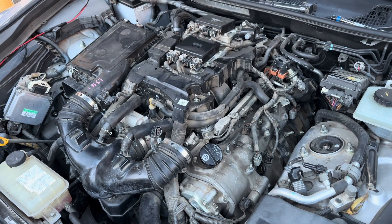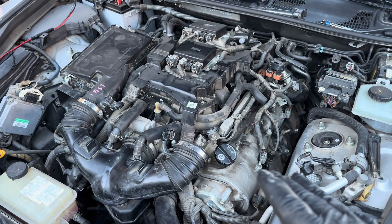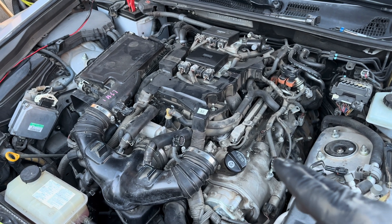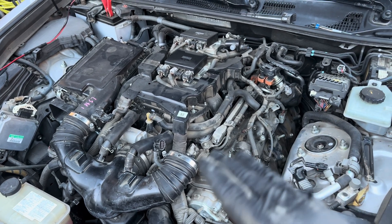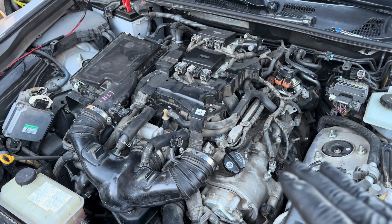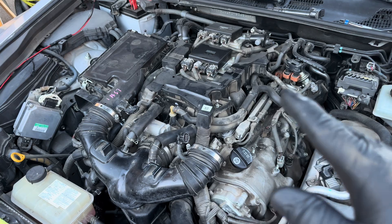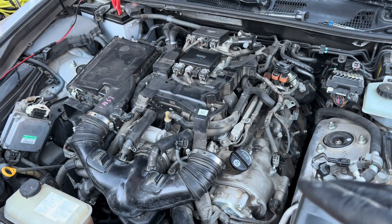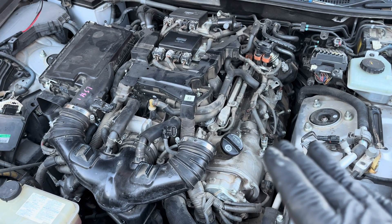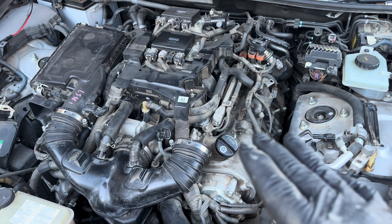I have to recommend it — it does work. But preventive maintenance would work even better if it had been done from the beginning. With any direct injection engine, if you get a new car, buy this stuff and use it regularly. It does work. If you wait until it gets out of control, you'll probably have to do the walnut blasting first and then use this to keep it clean. It's about $20 a can; the walnut blasting can range from $800 to $1,500. Big difference in price. Idle quality improved noticeably, and throttle response off the line was definitely better, though overall performance wasn't dramatically different.